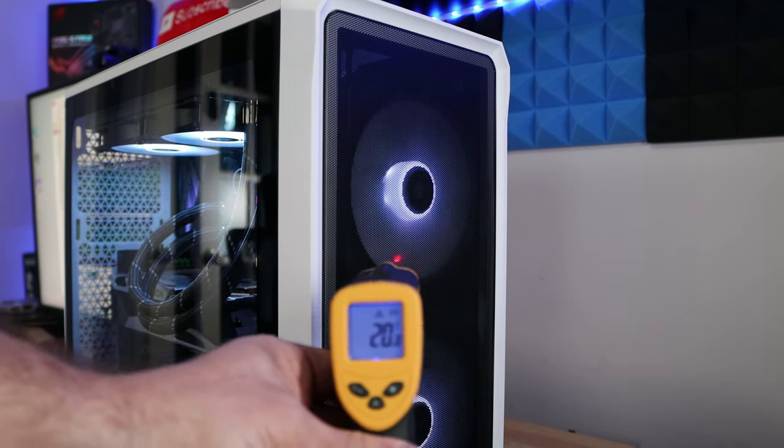Now, so much room, not really, because the largest liquid cooling unit we can add at the very top is a 240 millimeter. Now, at the front, we can fit a 280 or a 360, but we're going to impede airflow. And the front of the case typically is the most important to get nice and cool, fresh air. But, you know, pick and choose your battles.